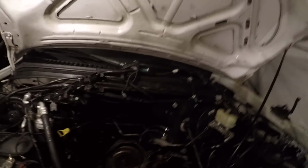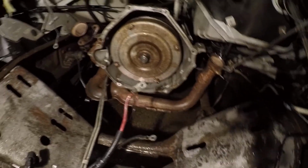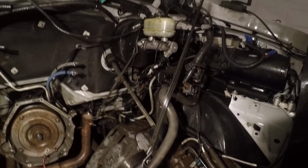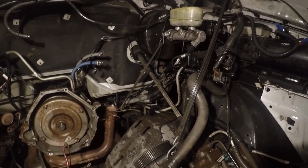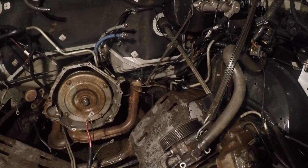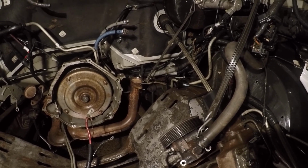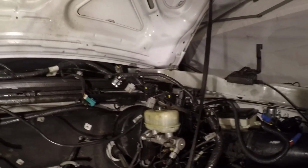Okay. I have finished cleaning out the inside of the engine compartment. We sprayed our degreaser in there, and then people are gonna like this. I went to the truck camper and I got a 1/2-inch PEX coupler with a female end on it, and then I got a male ended 1/2-inch pipe to garden hose, and I put that on the hot water outlet, the hot water drain out from the water heater. Brought my 25-foot RV hose over here to the truck, cranked up the water heater and let it run for about 20 minutes to get nice and hot, and then I hot washed the engine compartment.